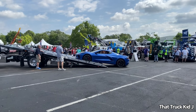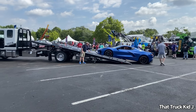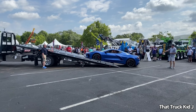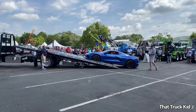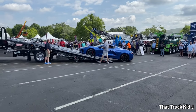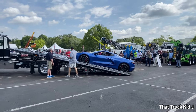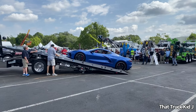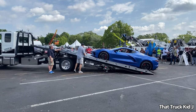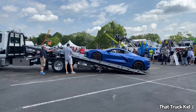The car's on the deck. This car isn't too bad, but sometimes you've got a problem back here with exhaust or overhang. If I raise that deck back up again, watch what happens to the clearance back there. The other option on here is the over-the-tire tie-down. This comes with two chocks that we can place into one of three positions — pull the tire up against that, it stops, and you know you're where you need to be. Then you can run your strap over the top.